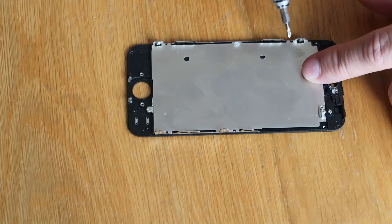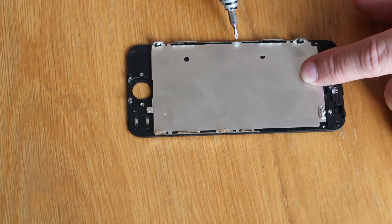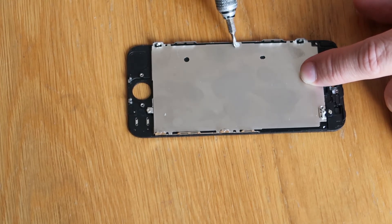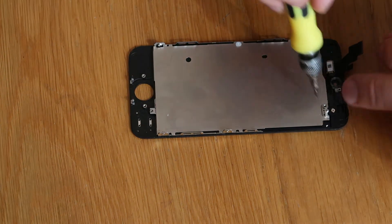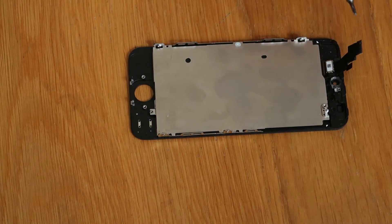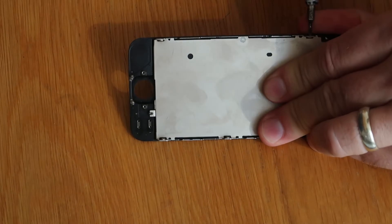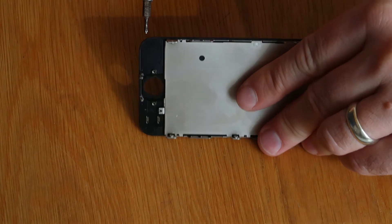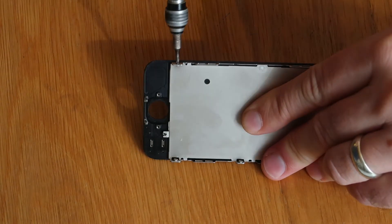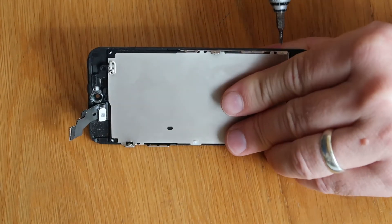The last thing is to undo the six screws holding the metal bracket in place — one, two, three, four, five, six. And as a nice repair tip: if this foam is red, it's been exposed to water, so you know you've potentially got a water-damaged handset. Sometimes though, if it's been in a steamy environment, they'll also go red and it hasn't actually been water damaged at all — it's just one thing to watch out for. It won't necessarily hurt anything, but just as a troubleshooting piece if you're having problems. There are a couple of them in the phone, so you can tell how far it's been exposed.